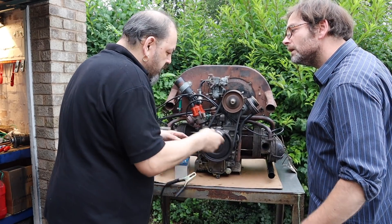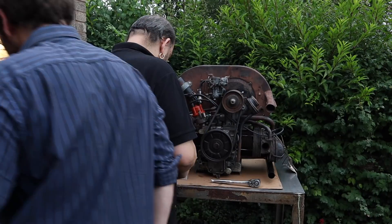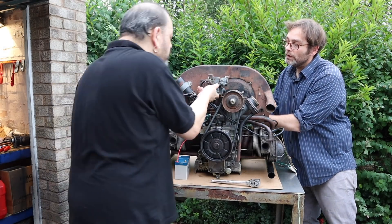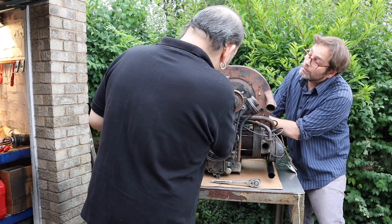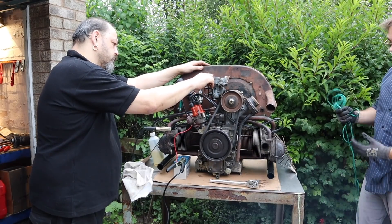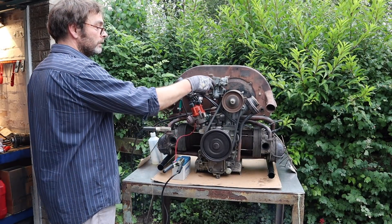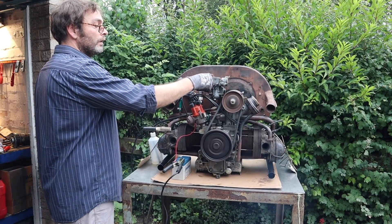Are you trying to advance or retard? I'm going to see how it runs by listening. You need to pull-start it again, sorry mate. That sounds freaking like a VW Beetle engine, doesn't it? You just need a little bit of tweaking. That pump's definitely working. We've definitely got a leak somewhere though — fuel leak or oil leak? We've got a fuel leak here. Did you put the gasket on the carb? No, I mean the top cover gasket? Full throttle, go. The timing needs adjusting.